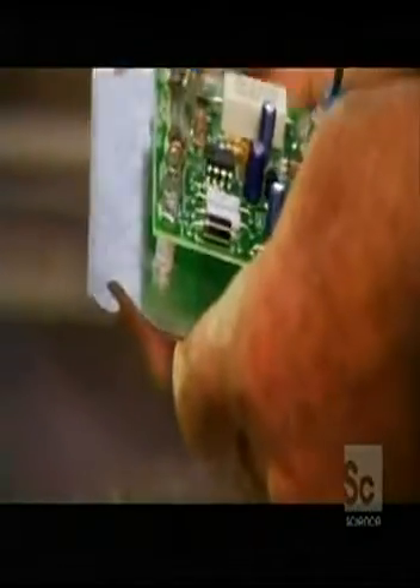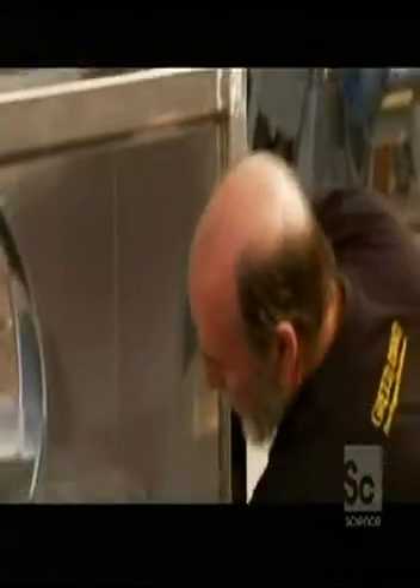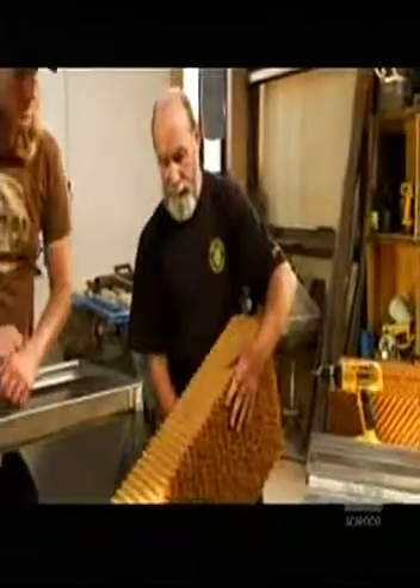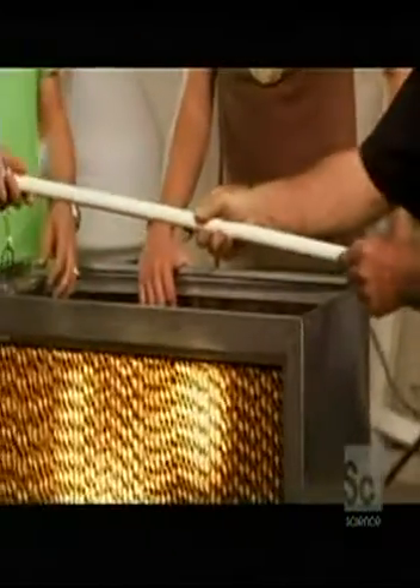This is a submersible DC pump. This is the electronic timer board that controls the pump. It's going to automatically fill — when the water level rises up, it cuts the water off. The pad material has arrows indicating up and airflow direction. These cellulose baffles maximize the surface area for the water to evaporate, and they've been treated with resin so they won't rot. The pump pumps the water up through the manifold — a piece of pipe with holes drilled in it — which drips the water over the pads.